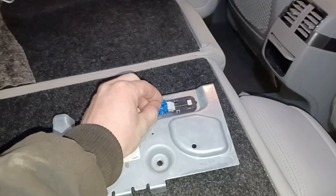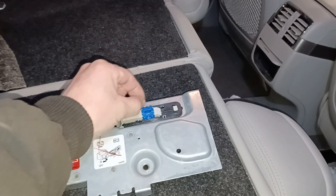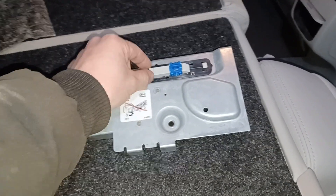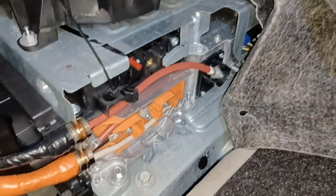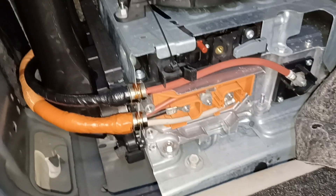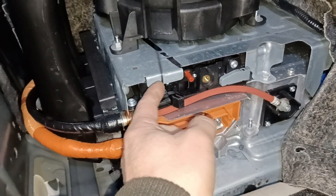First and most important thing: come back in here — this little connector position assurance clip, the CPA, comes out just maybe an eighth of an inch and then allows this mechanism to slide to the right. There's a little disconnect switch here which you basically just pull over and it disconnects power from the cables. I checked the terminals between every one of them to make sure — the book says less than three volts; there was no voltage because it was disconnected. I zip-tied it open. In the back seat is where you access that.